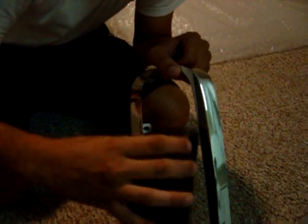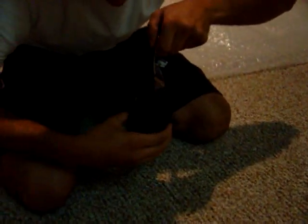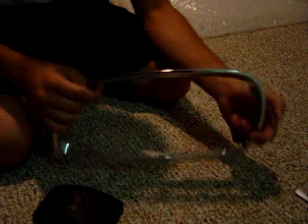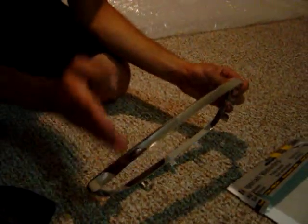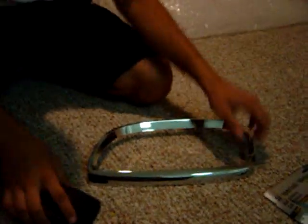Now all you do is start. You have a couple of layers that you need to watch out for. You have this layer right here, and this layer right here, and you have the one right in the middle of those two, which you can't get unless you go diagonally like this. You have one, two, three, and right here on the inside, four — all over. So just make sure you get everything. The easiest way to do it is sit under a light, and as you're sanding, look — if you can see the difference between the way you sanded and the light, it'll show up really well, so there's no way you can miss a part.